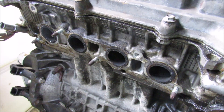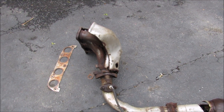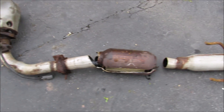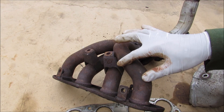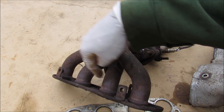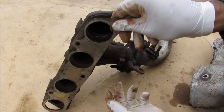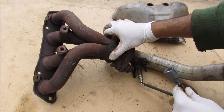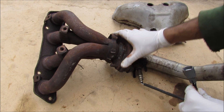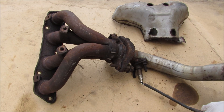Now here at the back of the engine is where the exhaust manifold mounts to. We've got the entire exhaust laid out here — the exhaust manifold up at the front, the catalytic converter in the middle, and the resonator and then the tailpipe that leads out to the muffler. Here is the exhaust manifold removed from the vehicle. This one from the 4-cylinder engine is a 4-to-1 manifold. You can see the backside and what the exhaust gasket looks like. We've got the heat shield, then the collector, followed by the exhaust flange, and then the air-to-fuel sensor before it goes out to the catalytic converter.